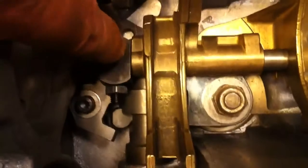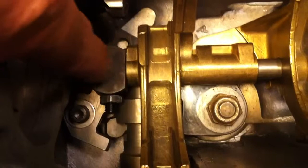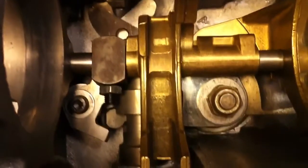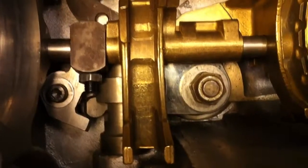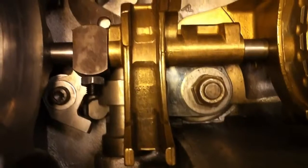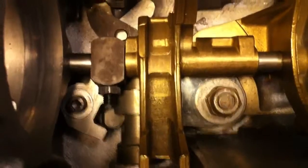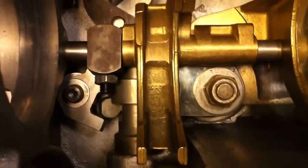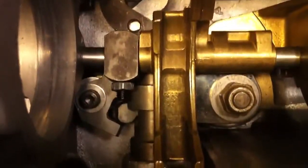And we can see down here that I've clearanced this just enough so that this 5th gear block goes into gear right at the detent, right where the perfect detent for 5th gear is. So there's no risk of overthrowing the gear and loading the little teeth here on the synchros a little too much. So this should be very smooth. This is what we mean by gunsmithing. We've just got this thing optimized in every way we possibly can. So 5th is nice and smooth.